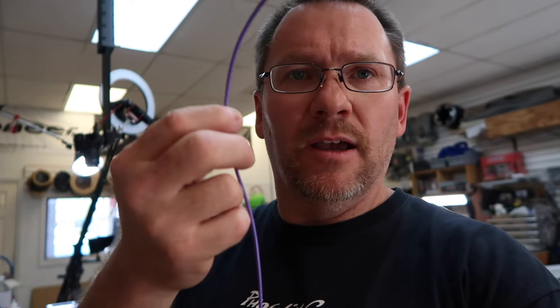You're going to want to get yourself some 18-gauge wire — if you're a stereo guy, remote turn-on wire will work fine. You want something thin. What you're going to do is run a wire from your light to behind the radio. If you're savvy and know where another spot is, note that it's not going to be in the fuse box — don't think there's a fuse in the fuse box to tap for the reverse lights. Sometimes you can find it in the kick panel; if you know the wire color from the back, you might find it up front and won't need a long run of wire.